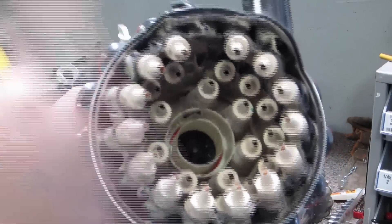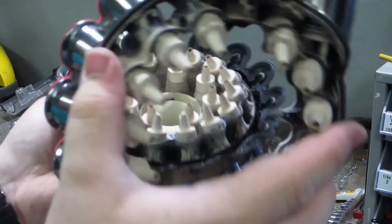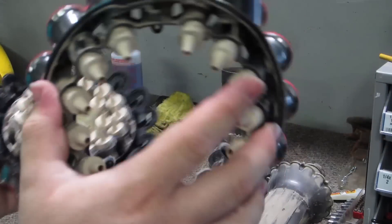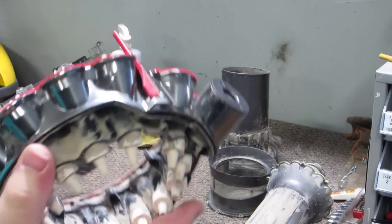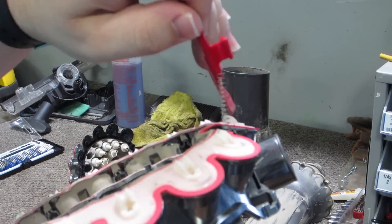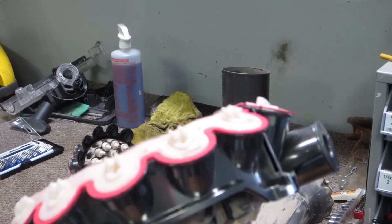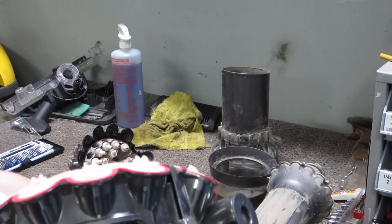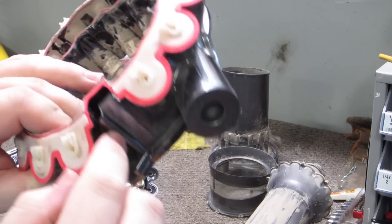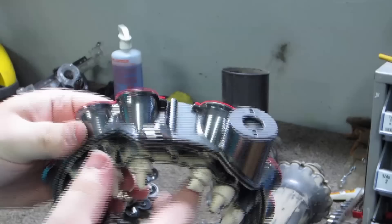The entire ring of screws is out, and basically what you're going to be looking at is now having two halves apart. What you will want to take out is the spring for the release — and preferably not drop it on the floor and lose it like I just did. It will also have to be twisted in a very specific way to maintain tension when you go to put it back in.